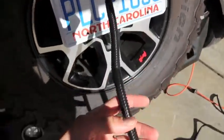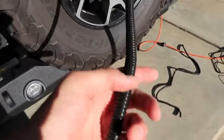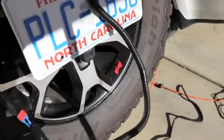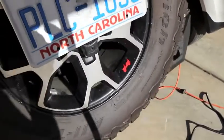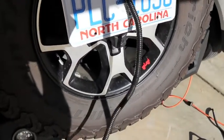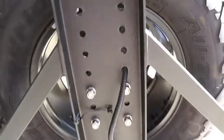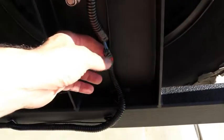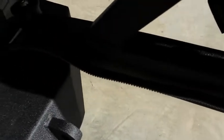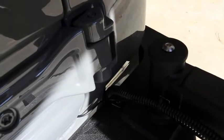I've just installed some sheathing on the wire to keep it tight and neat and also a bit protective. We're going to get this now installed back through here and then routed down under the Jeep. The wire is routed through here with the quick disconnect, which will simply slide through if ever it needs to be disconnected. It comes down and is secured to the tire carrier, then drops down below the Jeep.